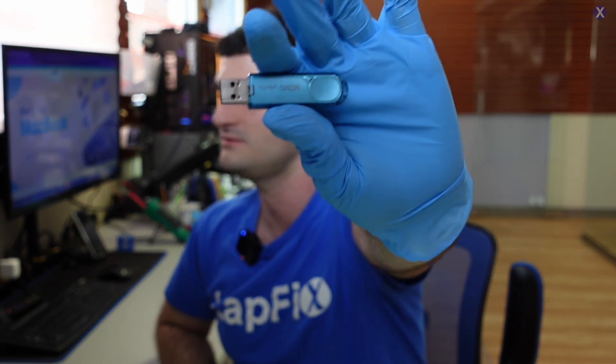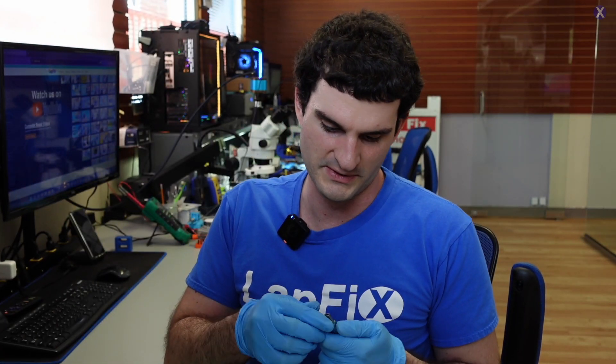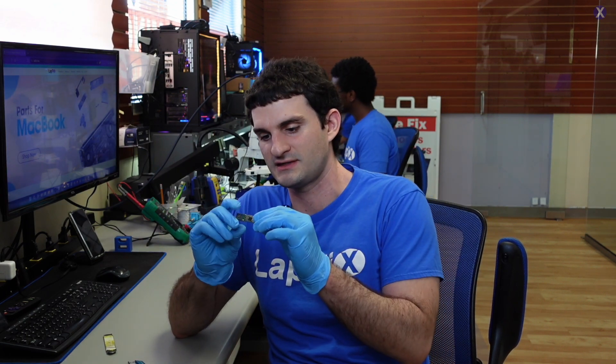The best thing to do now is take a look under the microscope and see what's going on. We'll crack this little bad boy open — these are plastic ones, so they're not too difficult. A lot of times you want to be careful because you have an exposed USB — it's very easy to knock components. Unless you know what you're doing, try not to open it, because if there's a knocked component or a missing component, it's going to make recovery more difficult.